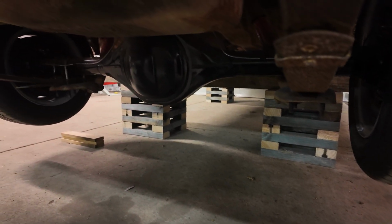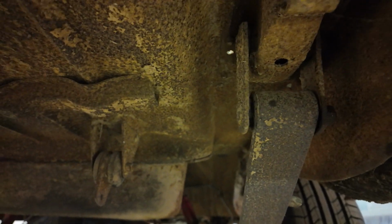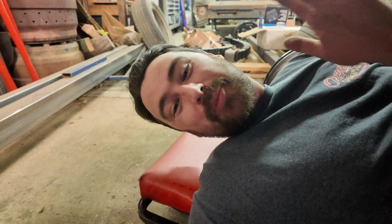Grab the weight of the diff, unbolt the rear hangers, get them apart, because these are an absolute prick to get apart because the spare wheel's there and the boot floor is there. They're actually a real pain in the ass. It's probably really the worst part of these cars, getting these spring hangers out. But despite that being an issue, they've got to come out. Whether I cut these shackles or not, I'm not too fussed, but they've got to come out because we've got sliders to put in, which means we'll have to drill the rivets out.